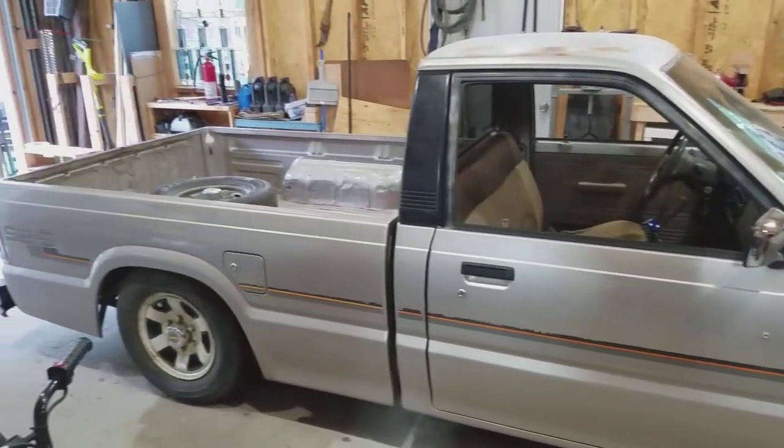Never mind this truck. I took it for the test drive - it did fine, but a couple of times it started sounding like it was starving for oil, and the oil light kept going on. It started sounding okay and then went back to bad, so I brought it in and parked it. I wanted to go to the store real quick - I started it up, no sooner got out of the garage and the whole top of the motor just sounded like there was no oil. It was hesitating and didn't want to go. I didn't put a new oil filter on it, so I'm hoping the oil filter is clogged.